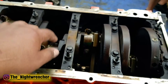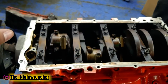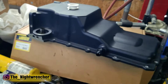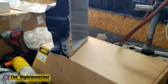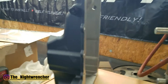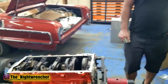In order to have access to the rods you have to remove the oil pan, the windage tray, and the pickup, but we're not actually going to install those components back on. Instead we're going to be jumping over to a component from the guys at JEGS. This is an F-body oil pan. Since we're going to be installing this on the Chevelle, we're going to need an appropriate oil pan to go along with it. This is a really nice unit — it's cast aluminum just like the OEM one, with a couple of features on top, but before we can install that we're going to have to go through a couple of things on the motor.